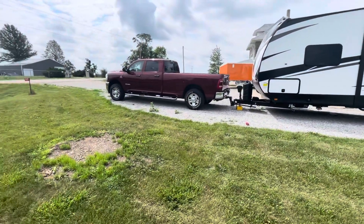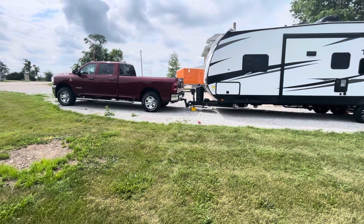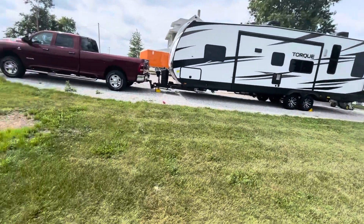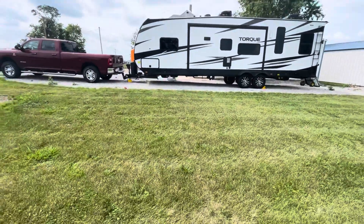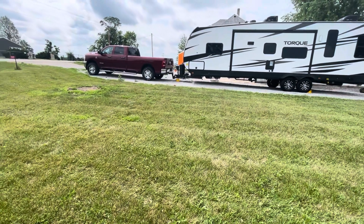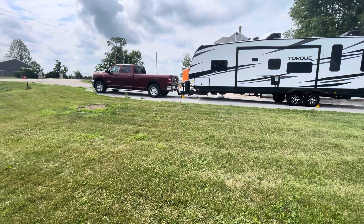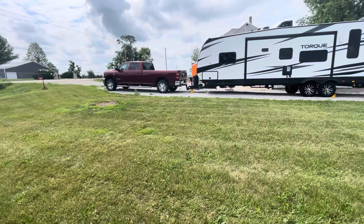That's better now — I put the bigger spacer in so the angle is more. The trunnions were harder to get on, so they're doing their job. I still dropped almost two inches on the back end. It does look nose down on the camper, so I'm thinking I'm going to move the ball up one hole. One hole is only maybe an inch and a half. Yeah, I'll do that — a lot of work but once you set it up you never have to do it again.